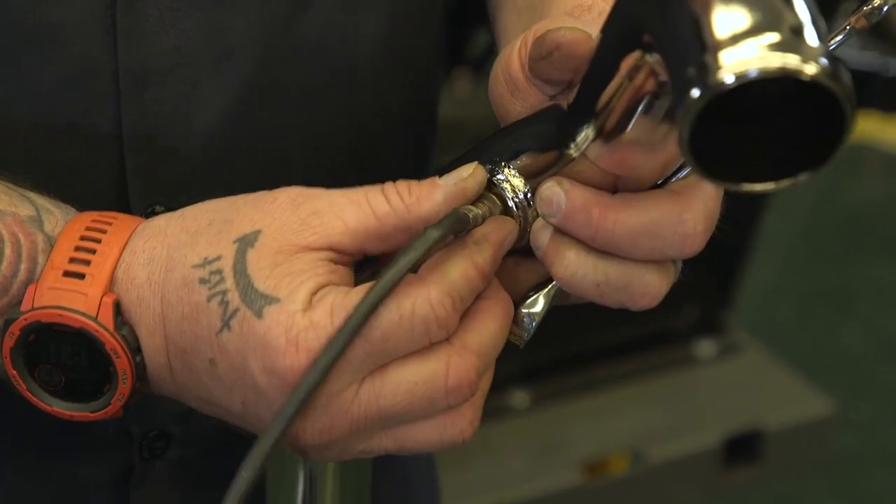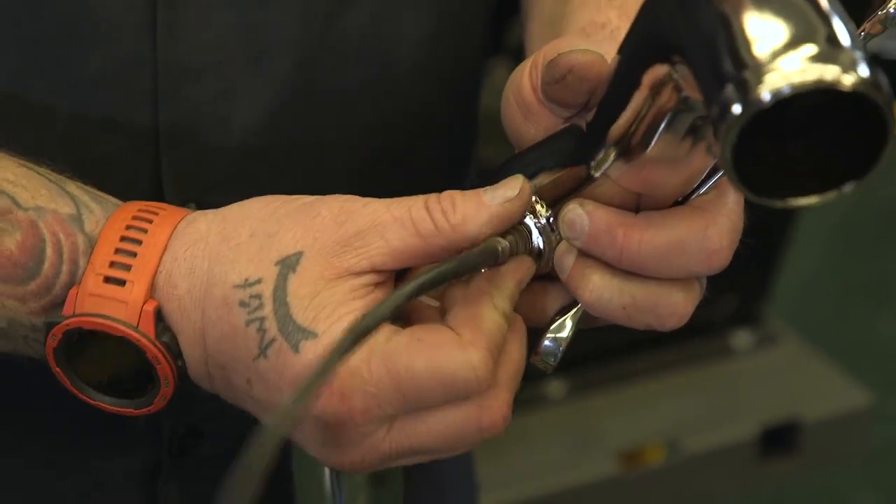The differences between narrowband and wideband and how that relates to your motorcycle is your state of tune. Late model fuel injection controllers rely on these O2 sensors to make adjustments. Most fuel injection controllers use a map — whether from a dyno shop that writes you a custom map or a standard tune. If you want to go further and run a closed loop system, that's where these sensors become even more important.